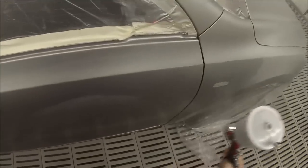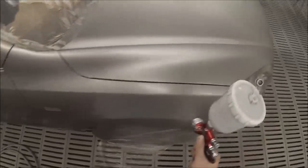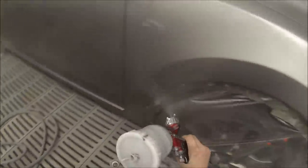Standox is the paint I'm using. I've used a fast reducer in the base coat, because if you use slow reducers it stays wet for too long, which increases the chance of fry-ups and map-up areas, or swell-ups around where your primer's gone or anywhere you might have broken through the clear when sanding it down. So I try not to use slow reducer.